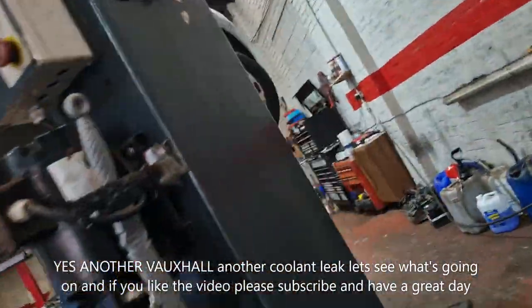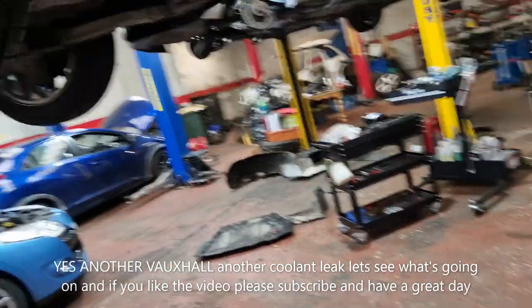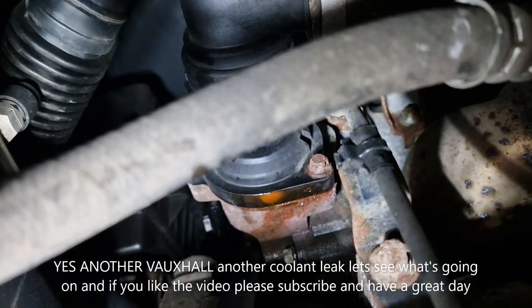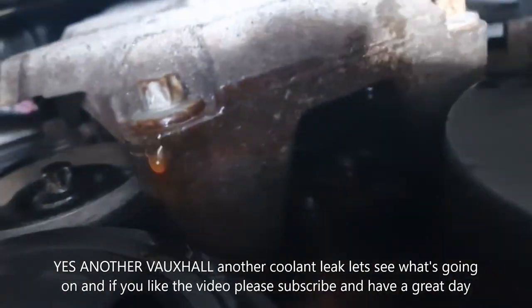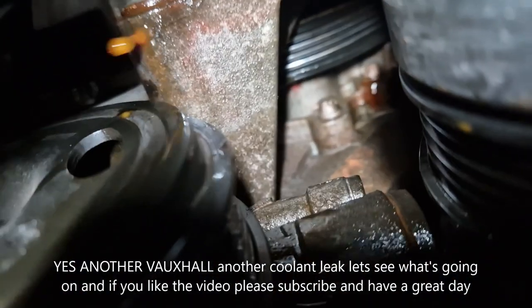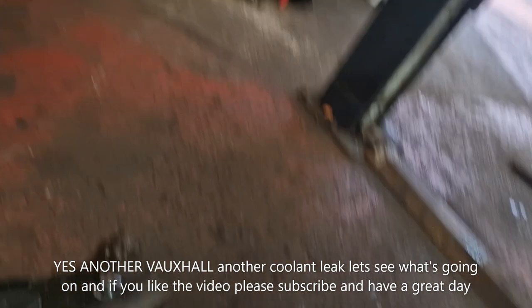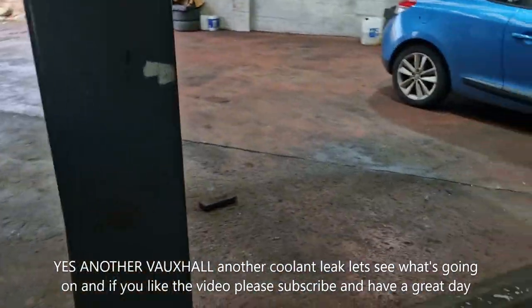It's actually got two leaks. It's leaking from the thermostat housing as well. So it's got a leak right there, if you can see that, right on the front of the thermostat housing. And then if you look at the water pump, it's actually running out the bearing as well. So you can see it dripping out of the pump onto my phone now. So there you go. Definitely the water pump and the thermostat.